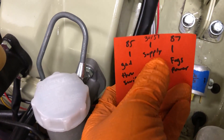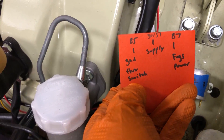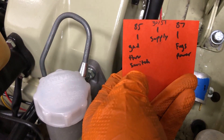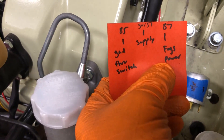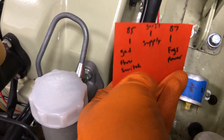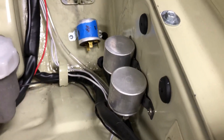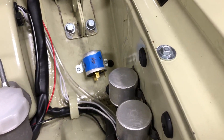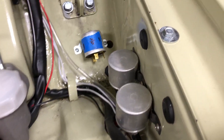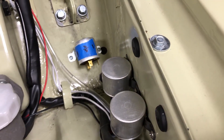Here's the wiring diagram for it. Supply from battery goes right into the middle, ground through switch, and then fogs power — so this is the output to the fog lights, battery power, and then the ground switch. Very simple. They use these relays for the reverse and for the headlights. I was trying to figure out how to get this to have signal from the headlights so that it really only turns on with the three-prong — it's just not possible.